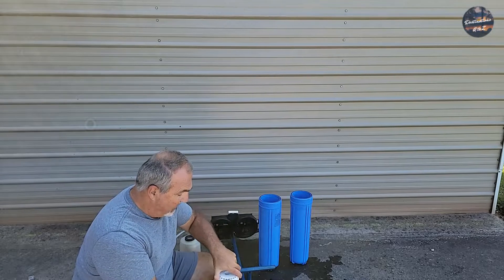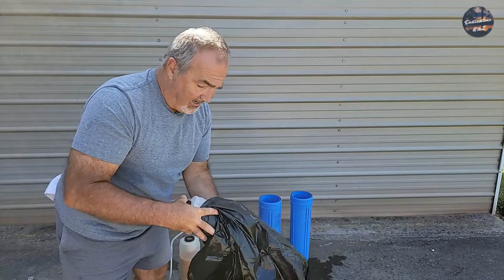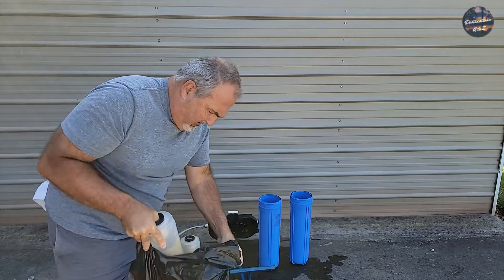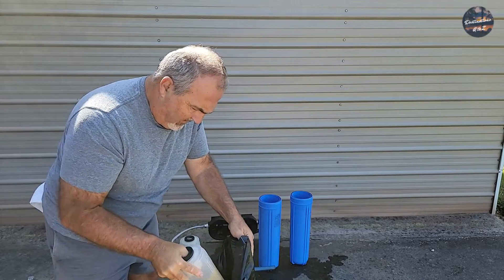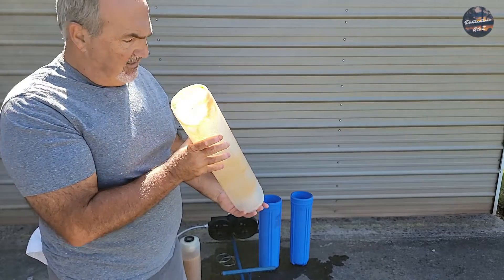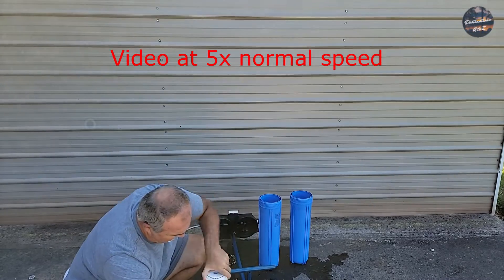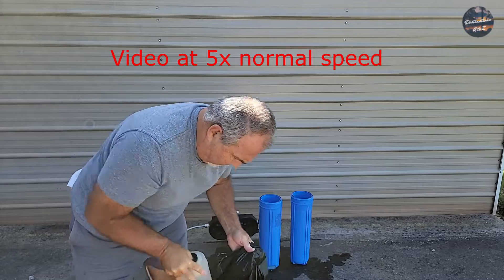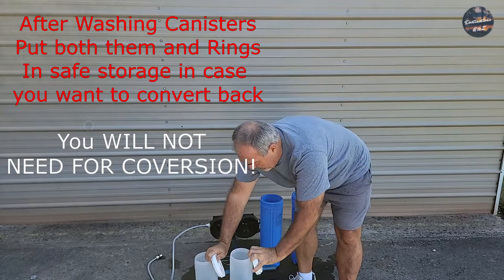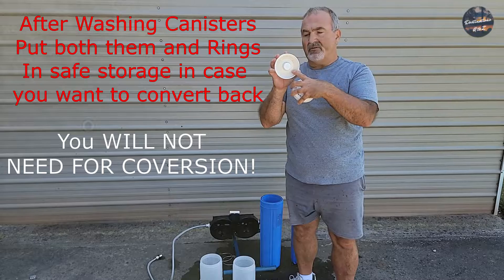Now that you have your tanks out, simply turn it upside down and remove it. You can see your resin right here. Put the whole canister in a trash bag and just start shaking — the majority will come out. There's still some remaining that can simply be washed out. Make sure that you do not lose your O-rings in the process. Here you can see the canisters — they're actually clean now, rinsed off. Make sure that you rinse off your filter as well, because there is a membrane filter in the bottom.